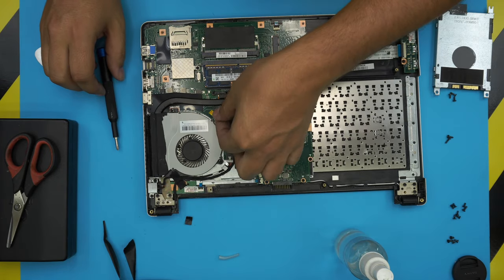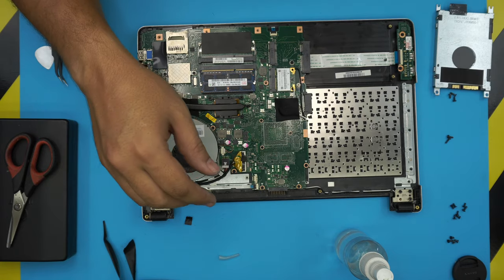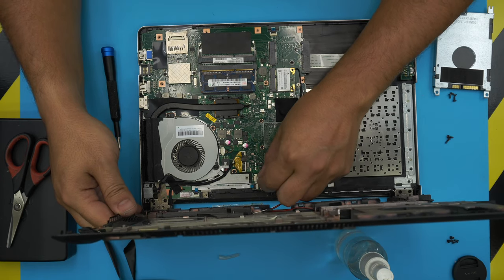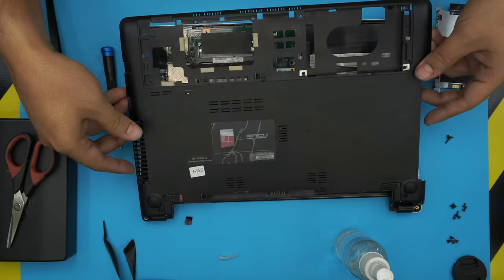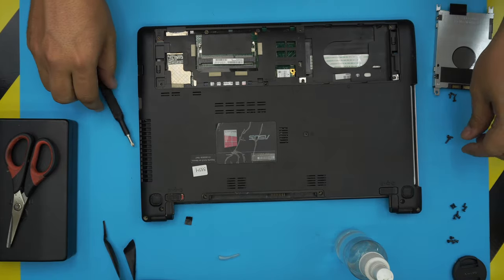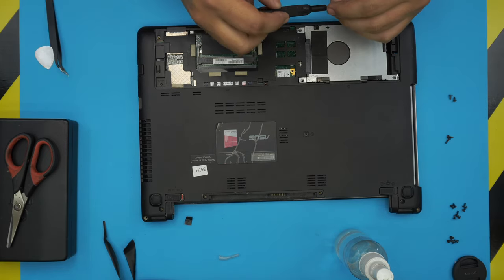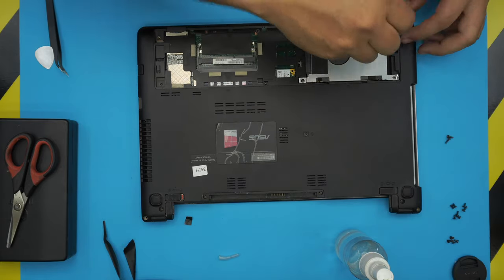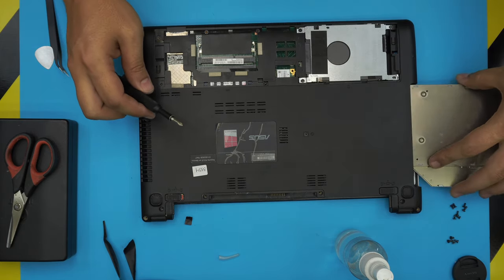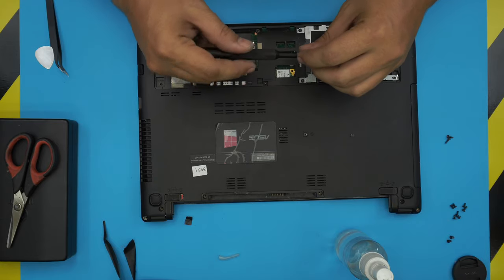Put the warranty label back on the screw and stick it down nicely so it doesn't come off and go through the fan. Now grab the bottom cover — after cleaning it up, grab the speaker jack and push it through, then bring the cover straight over and push it down, making sure you hear a few clicks on the corners. Grab the hard drive, slide it in, and put the screws for the hard drive first. Remember, there is no screw going in one particular hole, so don't put a screw there. Grab the optical or DVD drive, bring it over, and slide it in. Put the two screws on each corner of the laptop by the hinges first.